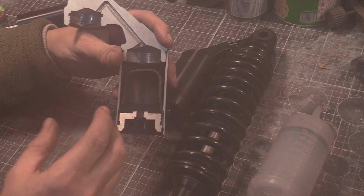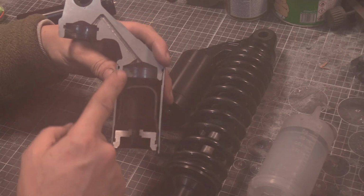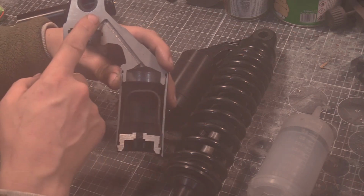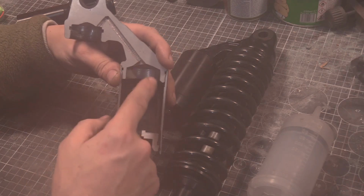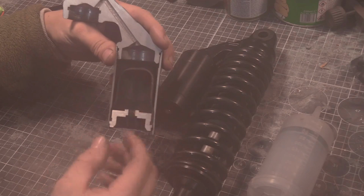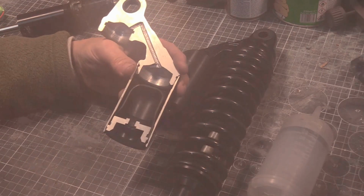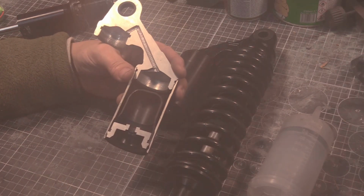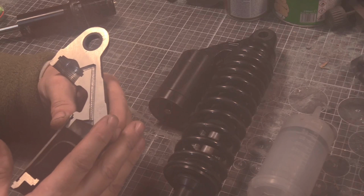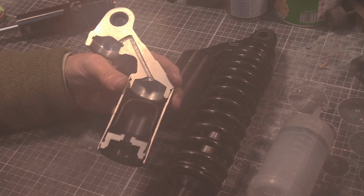what can happen is that the velocity, and this is why this is badly designed, but the velocity can outrun the inertia and basically create volumes because of pressure, and it can outrun itself, right? That's for compression, which is really, really rare. You get basically cavitation because you're trying to force something into a volume quicker than it can handle.